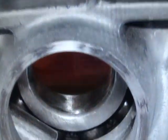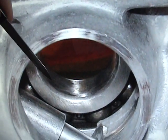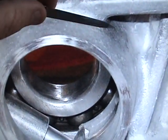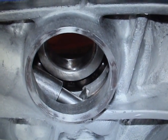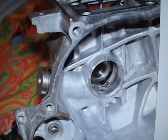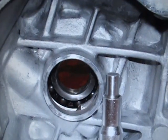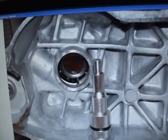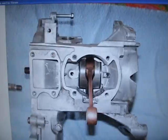The camera took some good pictures and you can see the bearing already in there. This bearing right here - it's a dummy bearing. You can see where I've put a Dremel on it - this area will be fixed right there. You want to keep everything nice and clean. While you're sanding or grinding, you want to pull your dummy bearing out - you can get stuff in the dummy bearing, it's no big deal - but take your parts out and wash them off really well to get all the aluminum debris out so it doesn't get caught in your new bearings.